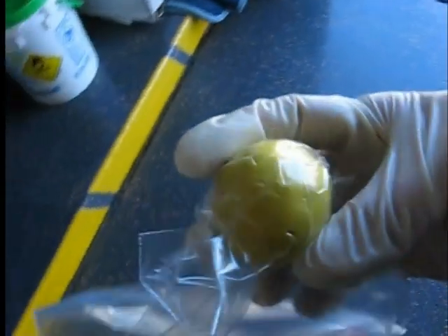Now we're going to wash the car instead of buffing off the residue. The instructions say to buff off the residue as you go, but why put in the extra arm effort? To me, every time you apply a cloth to your paint surface that's another avenue for swirls and scratches. You really have to press hard to buff it off, so just wash it off instead. The wash also helps remove the clay fluid from the stripes since we didn't clay those — we'll use the 303 on the stripes.